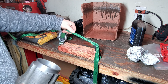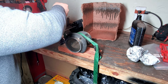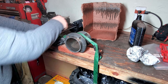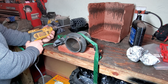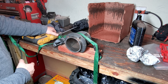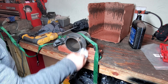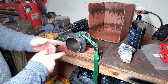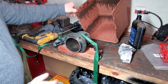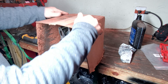Just a little cargo strap here to hold this in place. One of the things you want to make sure when operating this drill and plunging in here is to pay attention to your plunge rate. You want a nice steady motion and make sure the drill is already in motion as you're sticking it into the cylinder. You don't want to just stick it in there dry because then you create a dry line. I can even see some of the old cross-hatching that was in here before, which shows you how new these cylinders are.